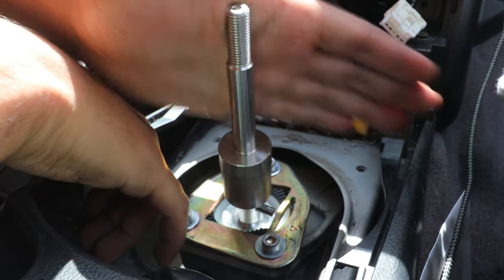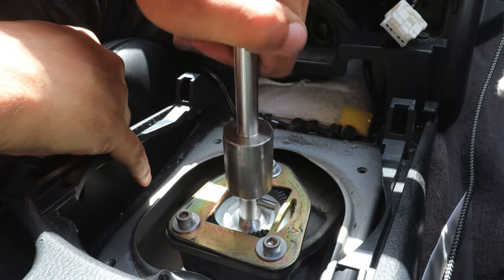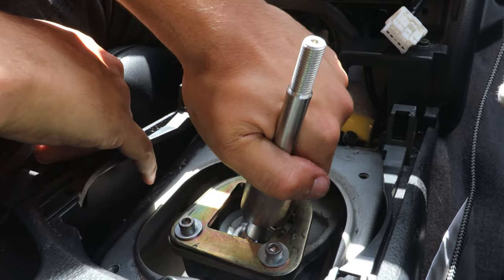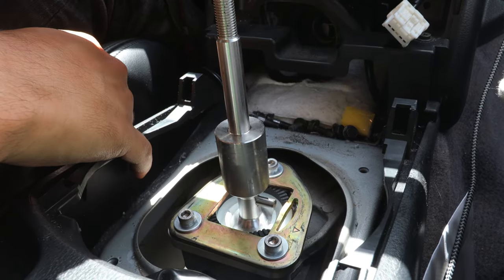Under the car, install the 12mm bolt — there are two little washers or spacers that go on the ball bearing first, then the 12mm bolt goes back in. Torque it to 10 foot-pounds — just snugging it up, nothing crazy. Make sure you can get into fifth, sixth, and most importantly reverse with no problem. Confirm there's adequate space between gears before finalizing.